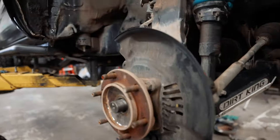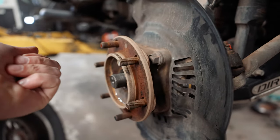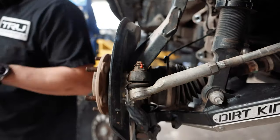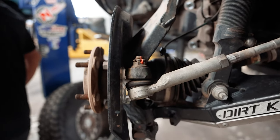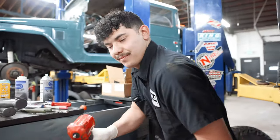That'll give this freedom so you can pull the whole spindle out to get the CV out. We're also going to remove the cotter pin and then Joel's going to hit that with the impact gun as well. That is a 19mm nut.